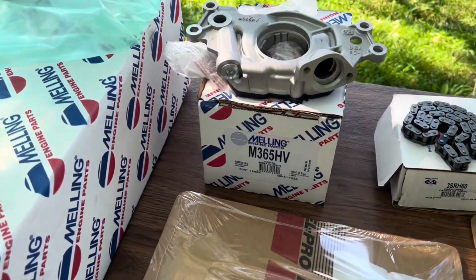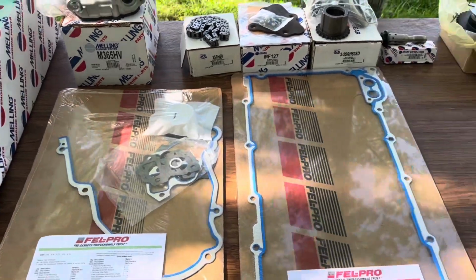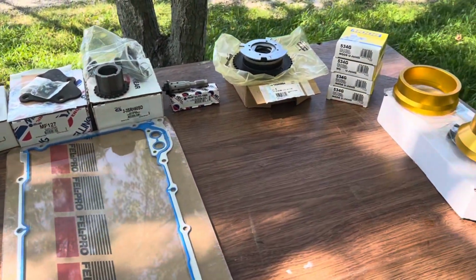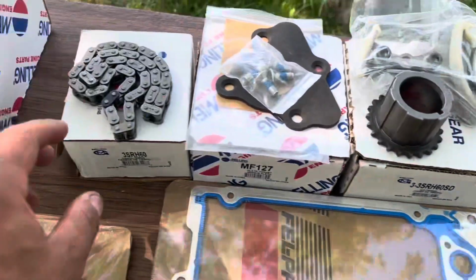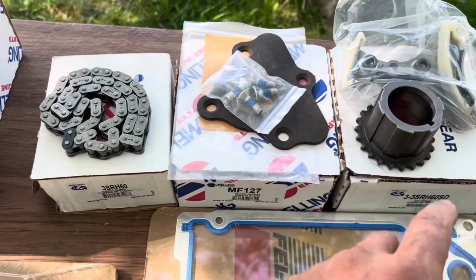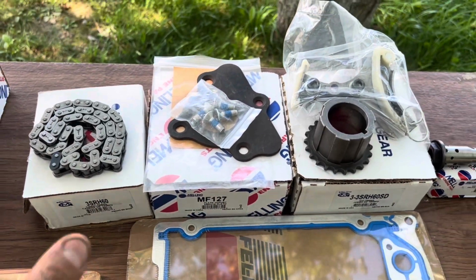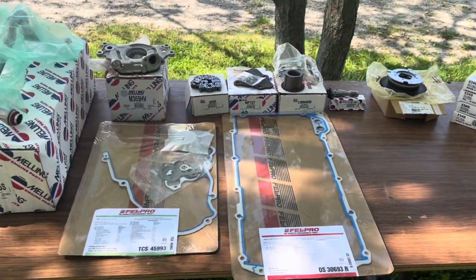All right. There we go, we got the P0011 code, and I'm thinking that this maybe needs to be changed out. I checked the timing chain on the truck. It's not loose or anything, it's got a tensioner on it. But we're going to replace all this. Okay, there it is.